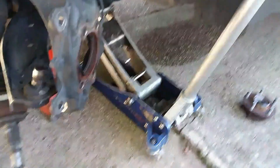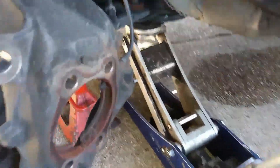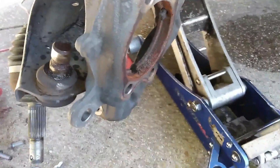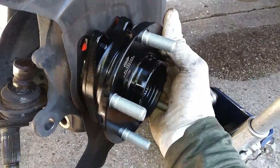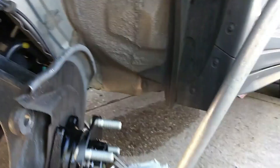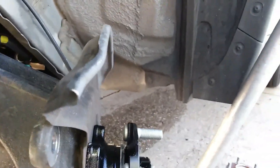That's the old bearing. You can take a hammer to it because it's the old wheel bearing — it's no good, so you don't have to worry about beating up on it to get it out. You usually want to clean out the area where the old bearing came from, then get your new one in. This is your dust shield — get that back in place. These bearings only fit one way; you can't put them in wrong. The holes only line up in one particular direction.